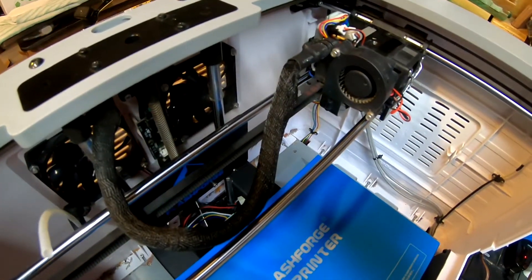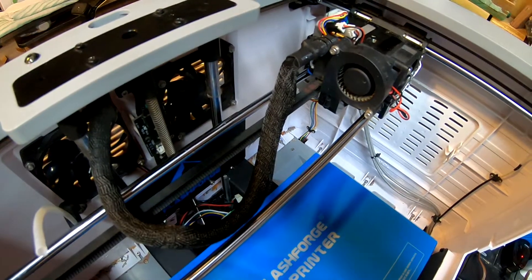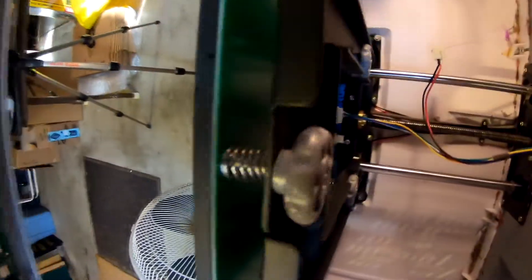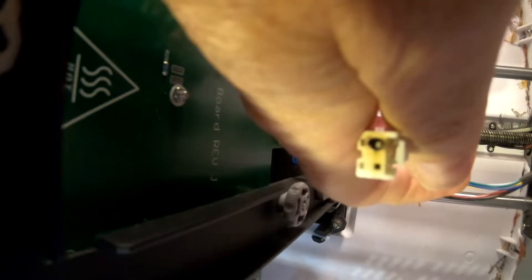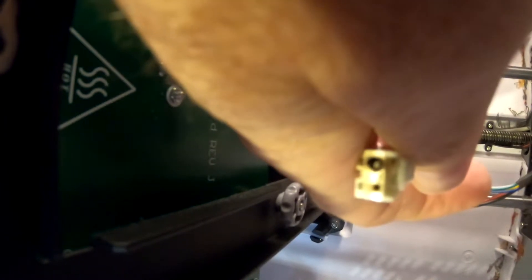So I'll tip it up on its back, and then we'll see what happened. If you look inside — I already disconnected the cable. The cable attaches — there are two cables attached to the back of the printed circuit board. One is the controls, one is the power. So I disconnected the power leads, and if you look at this, you can see that one of the leads is all melted and the pin connected to the printed circuit board connector came off. You can see the hole there is all melted and increased in size.